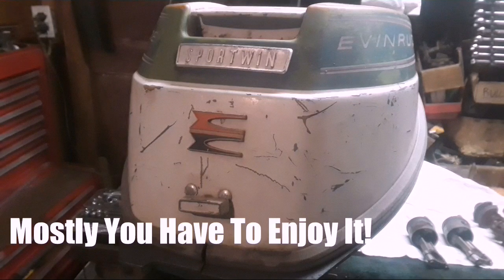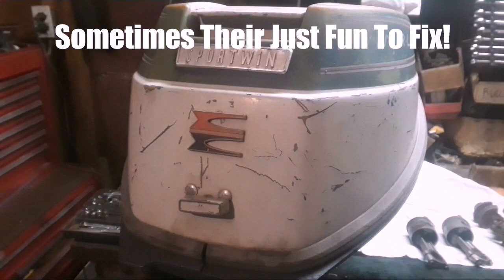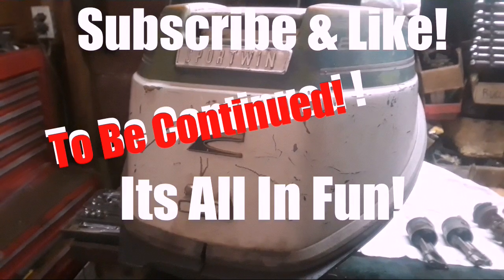They've got to rebuild the little unit too, and that was missing — a telltale sign that they probably had trouble with the water pump. It's just human nature: people don't change the pumps, they don't flush the motors in salt water and it kills them after so many years. That's what I figure happened with this motor originally — the water pump probably went bad, water got into number two cylinder, it locked up, they put it away. But we'll bring it back — that's what we're going to do. Stay tuned. Thanks for watching.